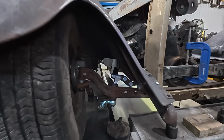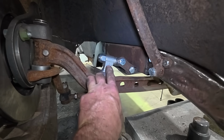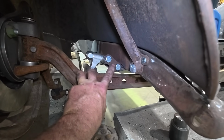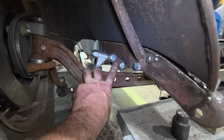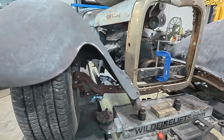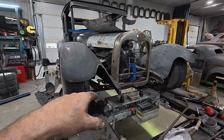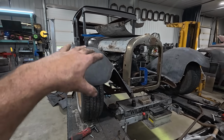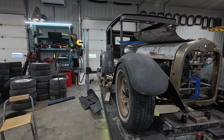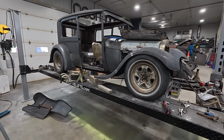And then, like I say, these are on, because the spring's so much smaller, I've turned these around. That's why it's wrong. That would probably lift this an inch if I did it, but the spring's too short and I had the reverse eye. I was just trying things and it's not working. I like the low, though. So I think with the reversed eye spring and a few leaves pulled out, I can get the car around here. I don't know if I wanted it this low. It's not bad. There's still plenty of ground clearance, so I'm not worried that way.